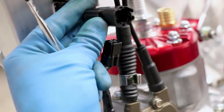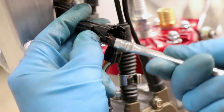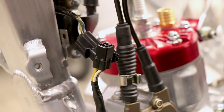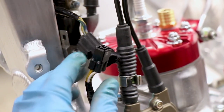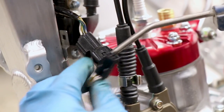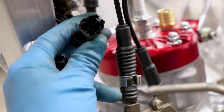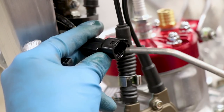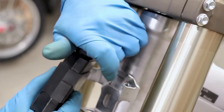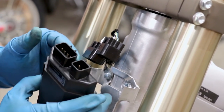I'll hit the other side of the connector as well, then let these sit for a few minutes and let the contact cleaner evaporate. Actually, just for peace of mind, I'm going to blow them out with the air compressor — and that was a good idea, because a lot of crap came out of there. Now I'm moving on to the CDI box to do the same thing — pop off the connectors and clean the grease out of there.